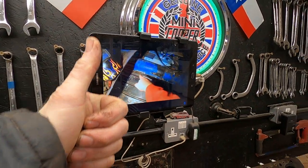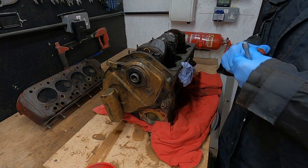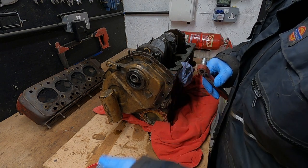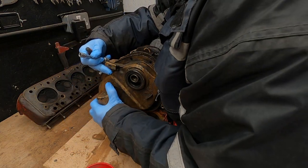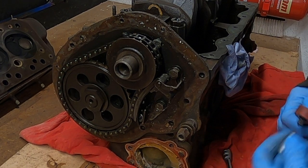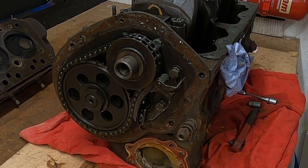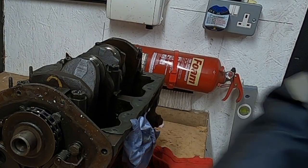So I'm going to seam seal this. I've ground up along here because it's had a floor at some point. Stitch welded. I'm going to seam seal that rear floor, then do the front floor, and that's kind of putting the nail in the coffin for this side really. So the plan of action is seam seal, let it dry, first coat of the stone guard underseal, however you call it. While that's drying, I put it into the seam sealer.